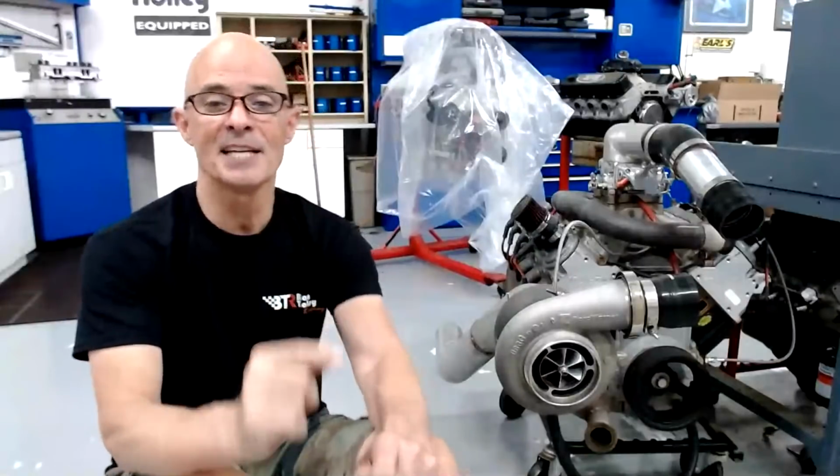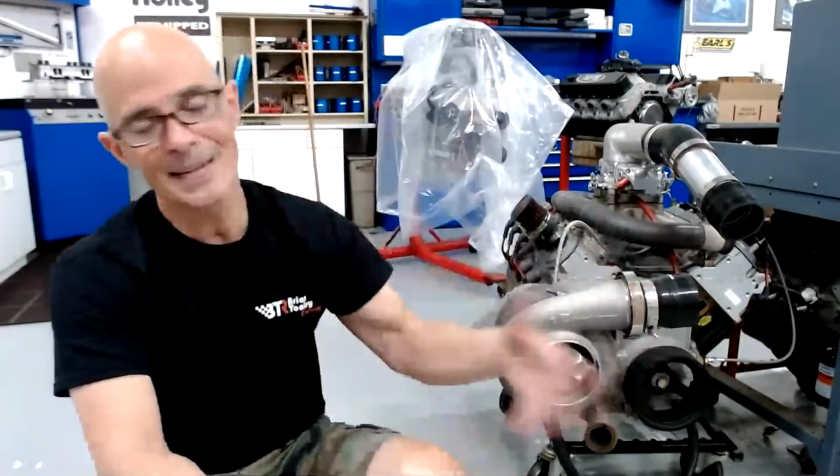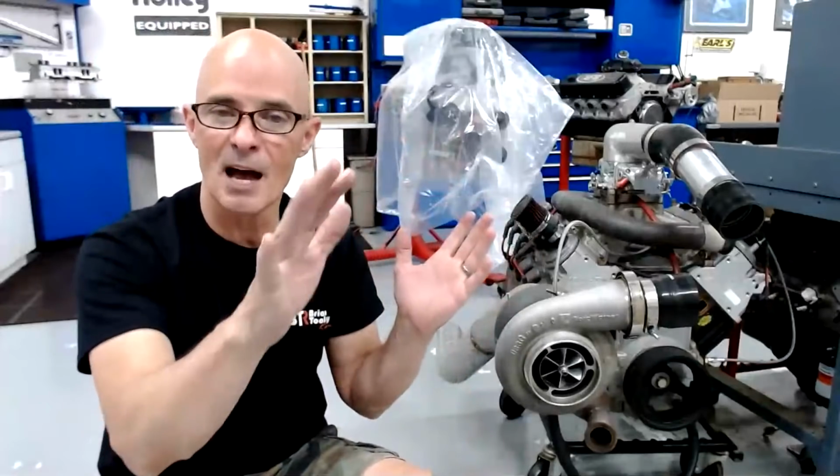If I put something up and make a change and it only changes it by 2 horsepower, to me, that's the same thing. It might not be for an OEM level guy, and it might not be for the Society of Automotive Engineers, and it certainly wasn't for us when we were doing Engine Masters, but that's why that kind of testing takes so long. It takes so much time to ensure that everything that you do is exactly repeatable. And you saw when we were doing that test, I'm not that concerned with the response rate because once the turbo got up and everything got hot, then the thing was repeatable even up at the top.